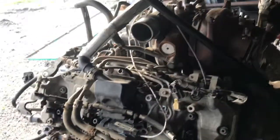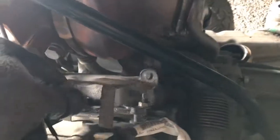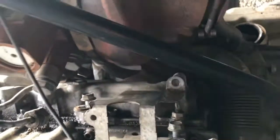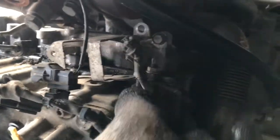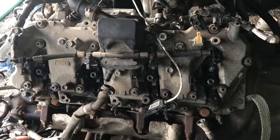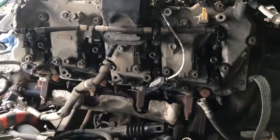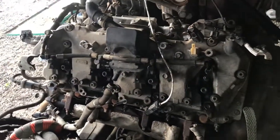Got the high-pressure fuel rail out. There's a little cover over top — I'm guessing it's a heat shield to keep the turbo heat off the end. There's a plastic plug on there that goes in the end of that like that. Get that out of the way — getting close, just about to where we start pulling the valve covers. Got the injectors to pull out now — mark them up, wrap them up real good, lay them out of the way, and then we're ready.